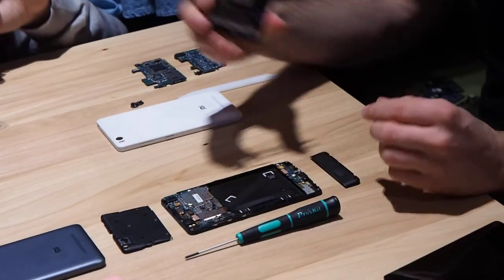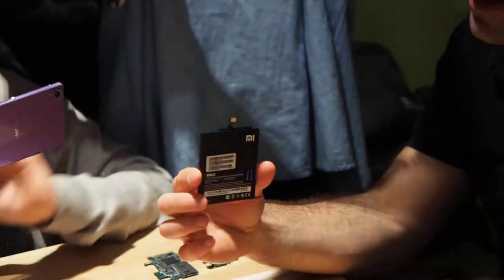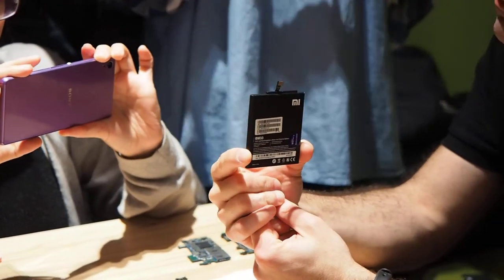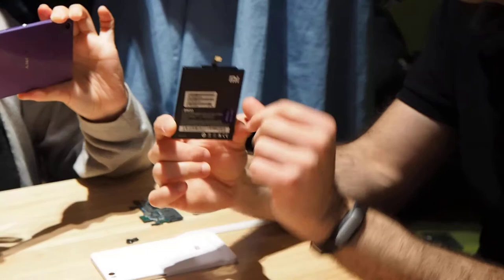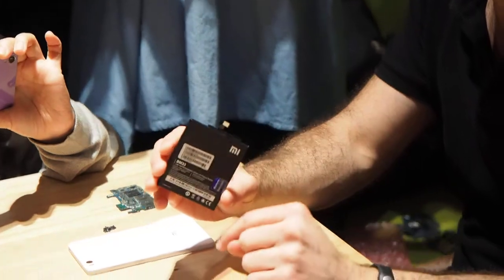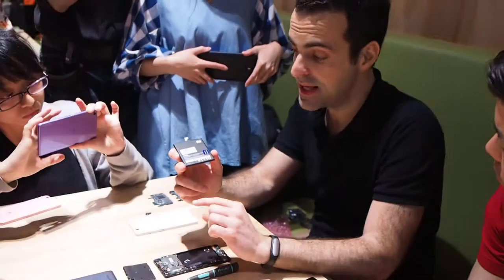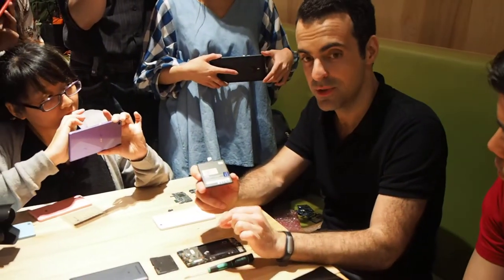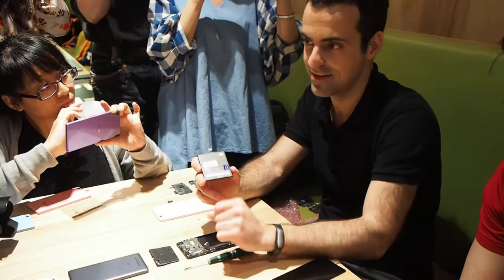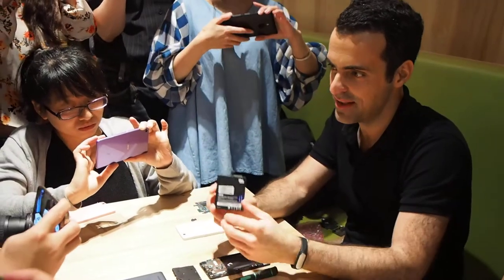So this is the world's most advanced type of mobile phone battery technology. It's using that 4.4 volt 700 Wh/L platform from Samsung and Sony primarily. This is the only device in the world today to ship with a 700 Wh/L battery above 3,000 milliamp hours. And it's actually only the second device ever to ship with a battery using this technology. The first one is actually right here, made by Samsung, by the same supplier of the battery. So I guess you understand that, right?